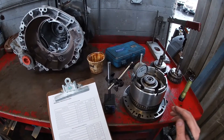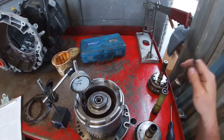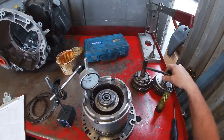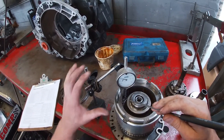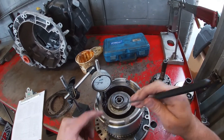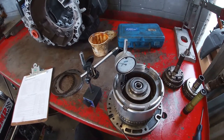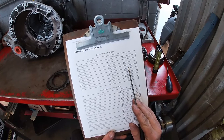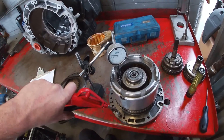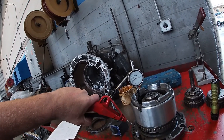Now we're going to move on to the overdrive. I've reinstalled the overdrive clutch pack with the two hub assemblies removed, which gives us access to reach all of the different clutch discs. I've readjusted the dial indicator to read down onto the overdrive clutches — this one is actually going to actuate downward. Going to factory specifications, our overdrive clutch should be between 19 and 92 thousandths of an inch, so we have a pretty big window. Regulating down to about 30 psi again.